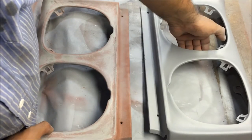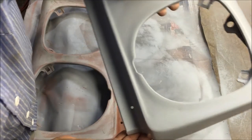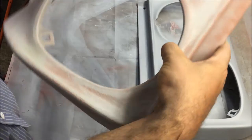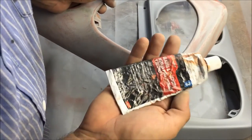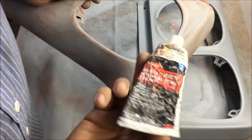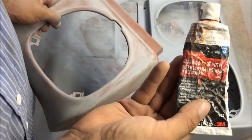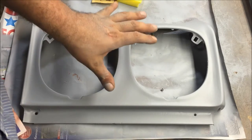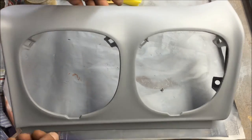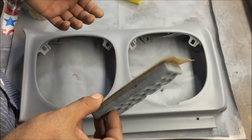Here's more information — I'm still priming this one and you can see that little thing I've been talking about. I thought it was going to prime out but it might still. The other side did have a weird little dent. For these little dents, I'm going to say no to using this 1K filler — you saw how we fixed that dent, we're going to mix some polyester putty. We've got about three or four coats of thick primer on here. Most people would put their guide coat here but since we did it first, we don't have to. Now we switch to 180 grit.